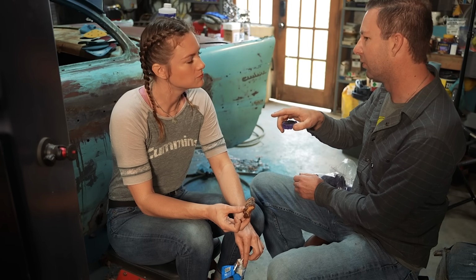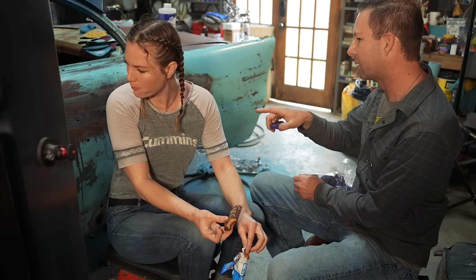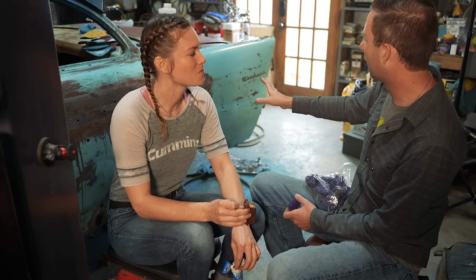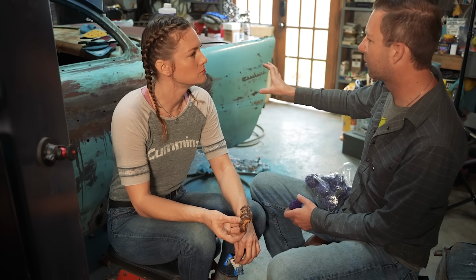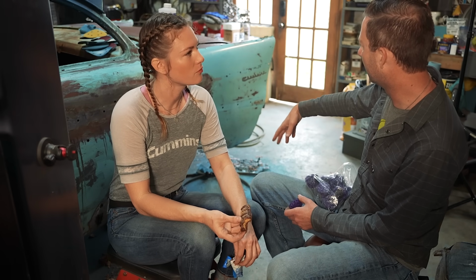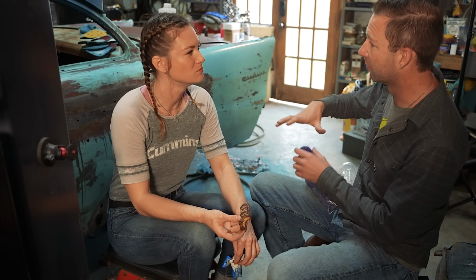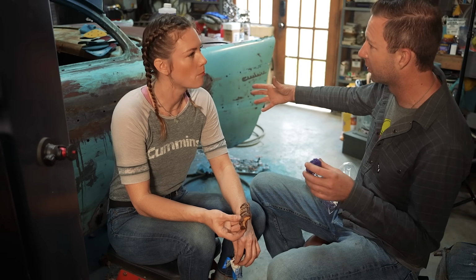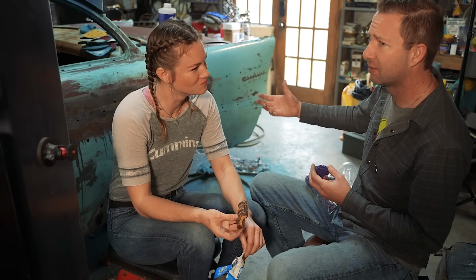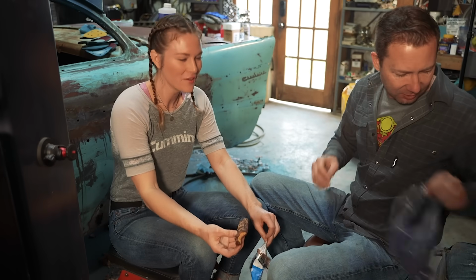And I tried it on the floor as well. On the floor, it really seemed to take that rust out, maybe even a little bit better than the wire wheel did. So I think I'm gonna work on this dent and try to get it down to metal, and then we'll put some stripper on that, let it melt off, bring the hood in. That'll be a very satisfying one where we get it on there, put maybe 3 or 4 coats, try that plastic tip. Yeah, anyways, I've seen that on a few videos, so we're gonna try that out.